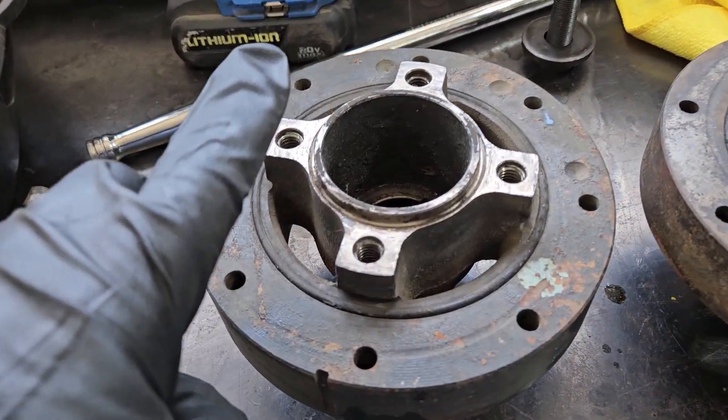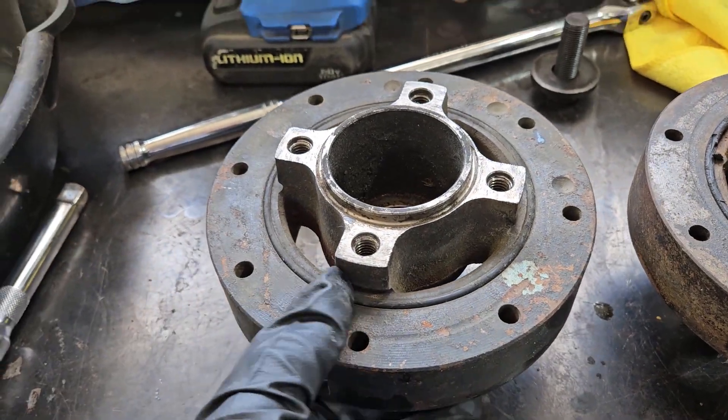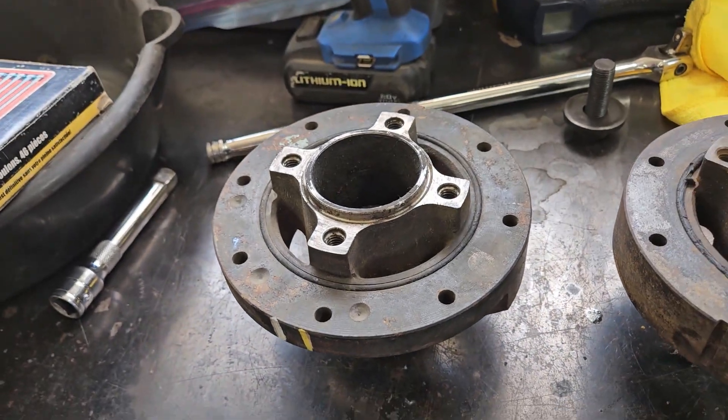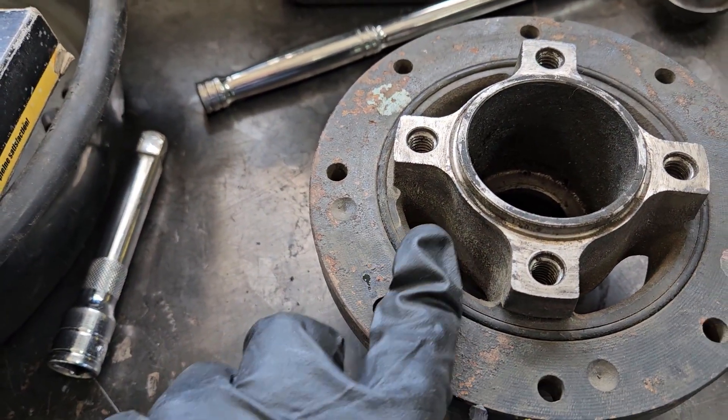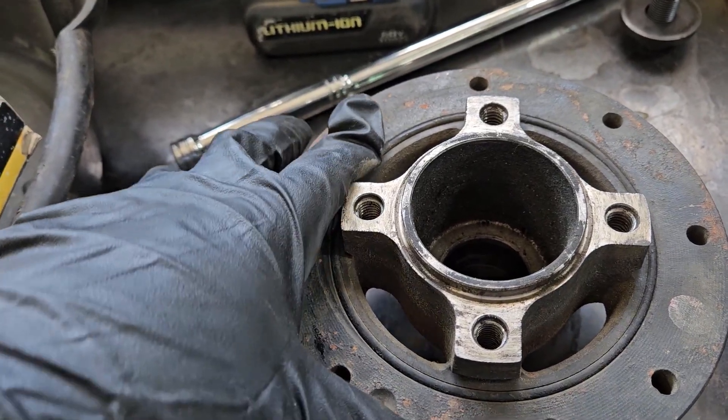When you're looking at a healthy one, you'll see the inner hub, inner ring, and then the outer dampening ring. You can see that it's got cuts, it's got timing marks — all the normal things you would expect. What makes these unique is they're two pieces and they're bonded together with a piece of rubber — thermobonded, I believe.